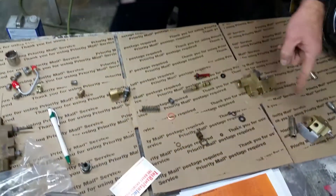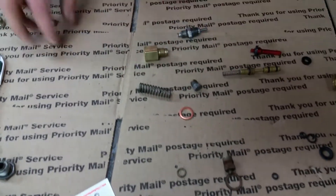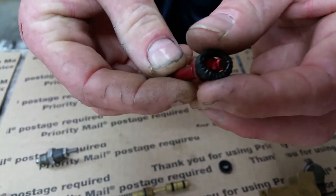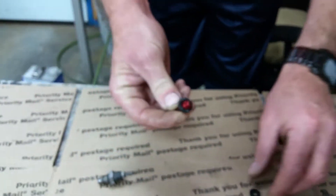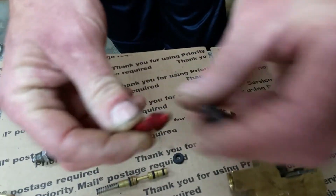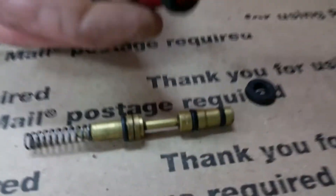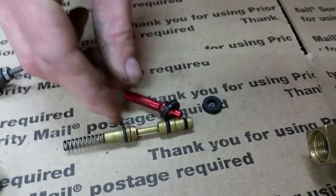Our friend is sending in components for his Barracuda — his combination valve, the TA valve — and here's a perfect example. I've got it all torn apart and the parts strewn out everywhere. Look what has happened to that proportioning valve cup — it has swelled beyond belief. Here's the new, rebuilt, correct one. Look at the size difference right there. Don't tell me DOT 5 doesn't cause any problems or can't react with anything, because anybody that tells me that is an idiot. With certain rubbers, especially older and natural rubbers, you can get a reaction going on.